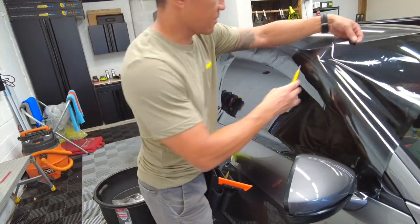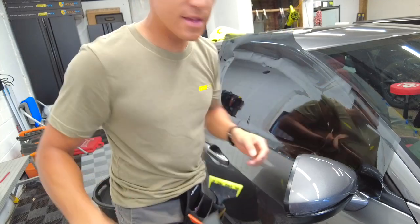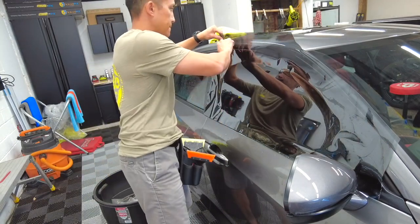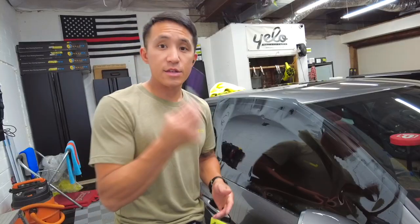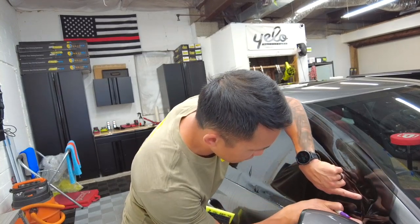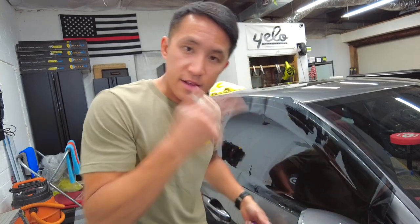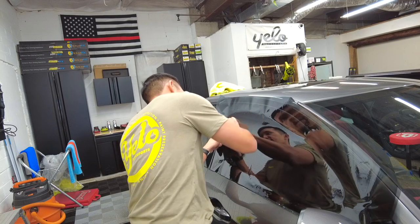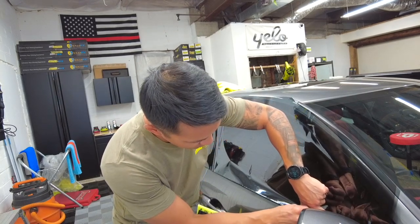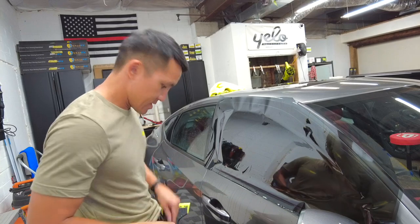Have a trash bin nearby. I'm going to remove the excess — sometimes it's trash, but in this case I'll keep it because there's a small quarter window it could fit perfectly. I bust out my marker and push with my fingers gently from the inside, going all the way to the edges. When I get to my edge I use the marker to mark the side — same on the other side. On the bottom, I roll my fingers in and put the marker behind my finger as a guide to give me my line. Now I have my three sides marked.